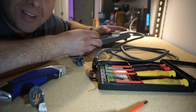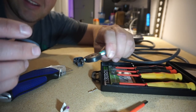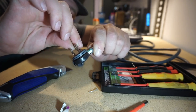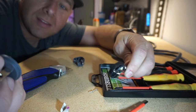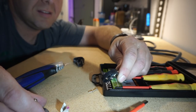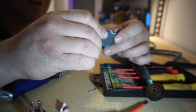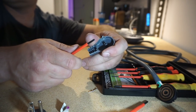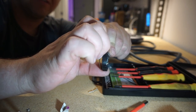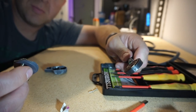This thing claims it's good for 1,875 watts. And all of that is going through these little tabs that are just sitting here. That seems absurd to me. Wow. Yeah, so you can tell this thing got hot, that's for sure. This little spring, I think it's intended to fly across the room, but also keep pressure on this, but, boy. Yeah, that's a pretty bad design.